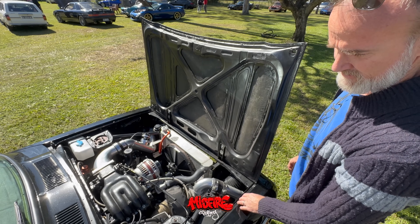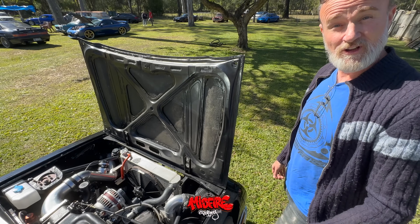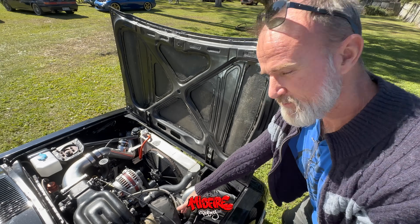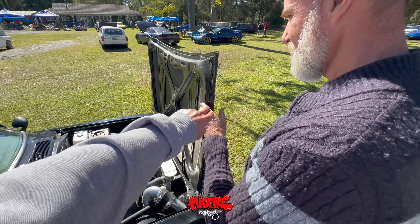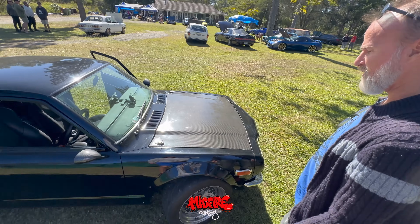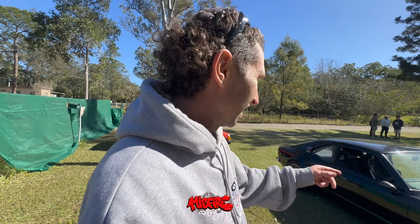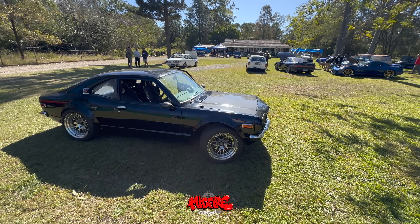You can see all of the adjustments available in the camber and caster. All the guards have been modified so it gets more turn-in, which would be great for drifting, especially with the rack and pinion instead of the steering box. They've got front tubs as well as rear tubs, and extra supports in the front. The carbon fiber bonnet came with it — I'm going to put a normal bonnet on it as well, but it does look pretty mean. It suits the fact that it's an old car that's got a lot of modern stuff in it.